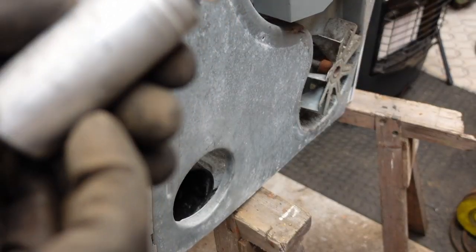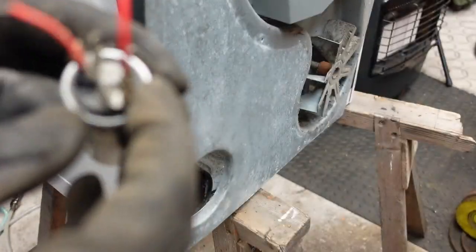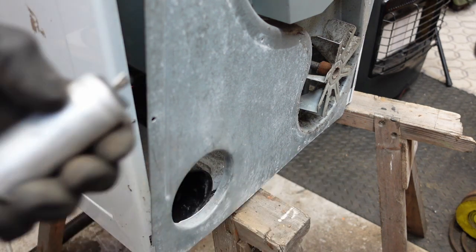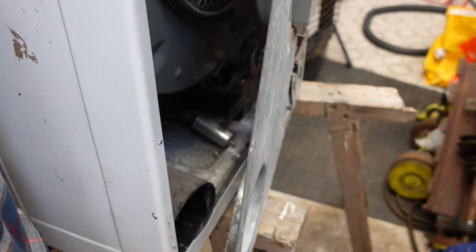It's not the worst job — I was expecting it to be a lot worse. By sheer good luck, I have another one that says eight microfarad on it, and it has two connections. Let's pull those jumpers off. It doesn't matter, if I recall correctly, which way around these go. I won't be able to see what's going on here. I want you to see my keyhole surgery. The issue is getting two hands in — it's tricky. There's two wires on one side and one on the other, so I don't have enough. I need a jumper or spade connector and I don't have one.